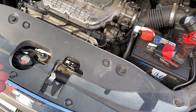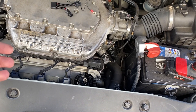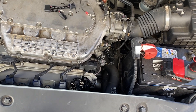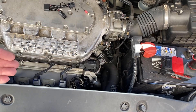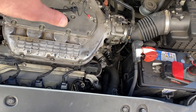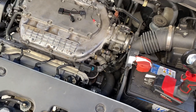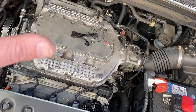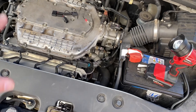Now, I've also been feeling in cruising mode some imbalances from the engine — the car shakes a little bit — until you hit the gas again, which turns off the VCM deactivation and it goes forward fine. There are some electronic dampers somewhere that are quite expensive to replace. So I'm really doing this not for that, but for the oil consumption, to try to extend the life of this engine.